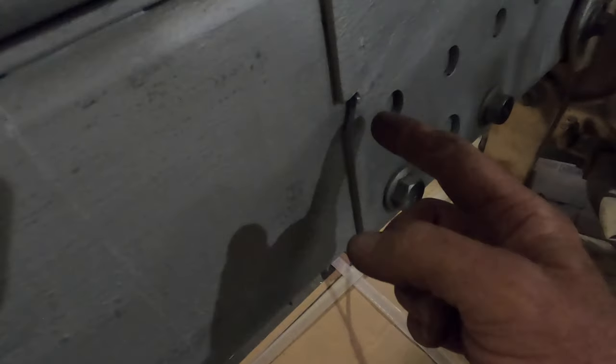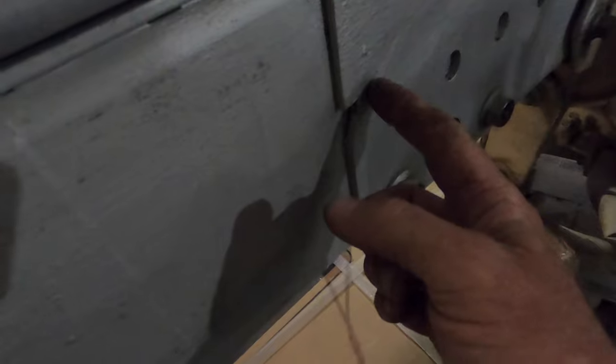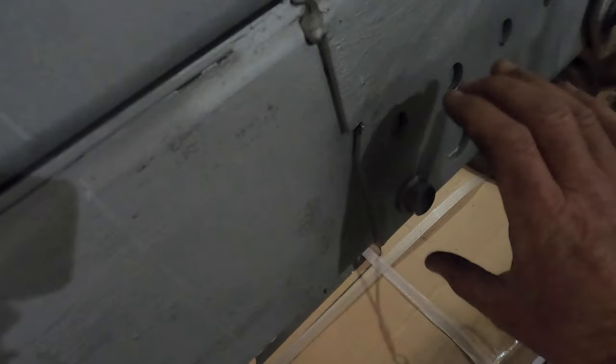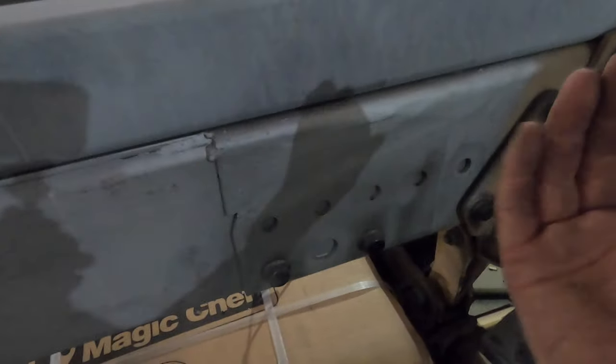If you've seen the old hitches, they have a flat piece that mounts down here through these holes. There are five holes here. That piece comes over, comes up, and sits up inside of here. The top comes over, folds down, and then these five bolt holes here line up with that. So you have these two layers that come over and tie together to this frame to give the hitch some rigidity. What we're going to do is cut those tabs off up there and then re-weld them in, and drill some new holes in the frame on both sides, and get that put back together.